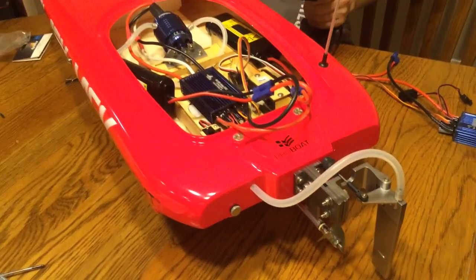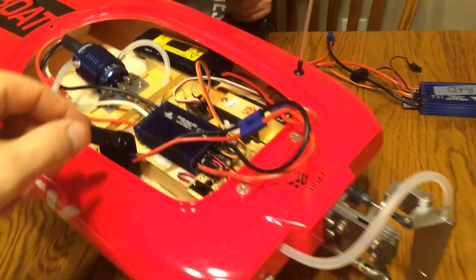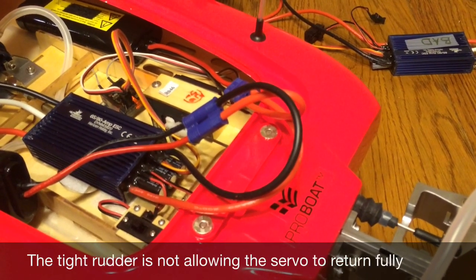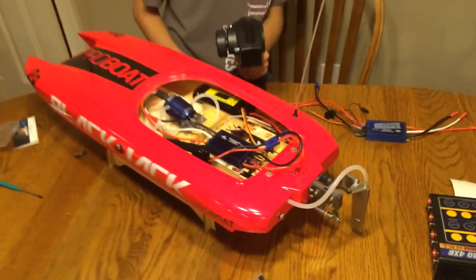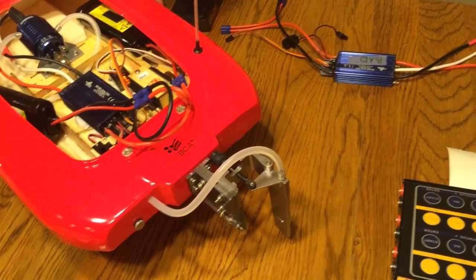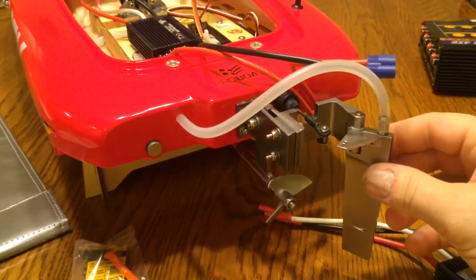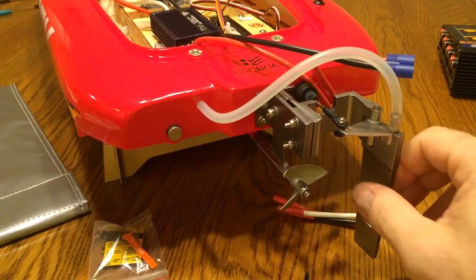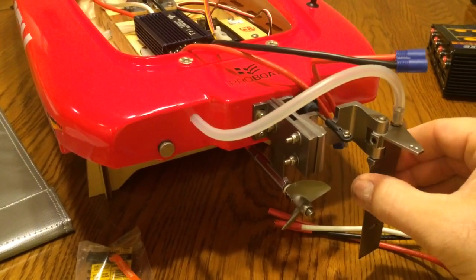The steering is acting a little funny. I wonder why that servo is making all that racket. That's weird. Maybe we'll run this tomorrow and then we'll burn this one up with a power supply. We found out why the servo kept making noise — it couldn't return to neutral, the rudder's too stiff. We'll have to find a way to loosen that up some.